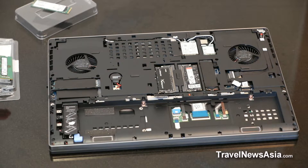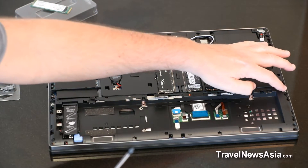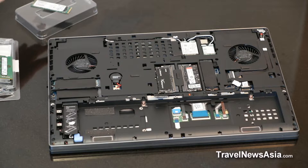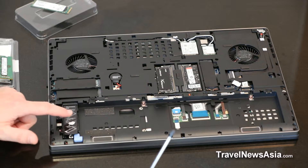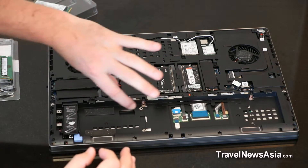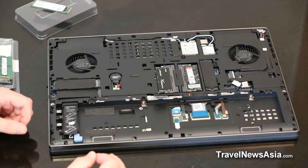So there we are. As you can see, very easy to remove the back. There are simply two screws connecting it, one on either side of the 7730, and then you have the back of the laptop in all its splendor. Now, what you have here is the one SSD slot. As I mentioned earlier, if you chose the smaller four-cell battery, this is where the 2.5-inch 7mm hard drive would go in.